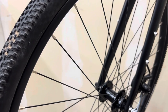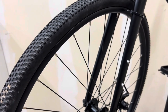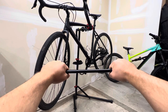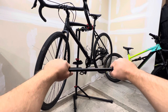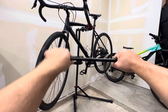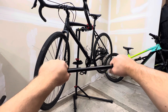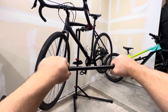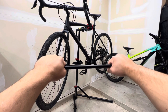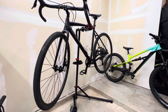We're going to loosen that up in hopes of putting more tension on the opposite side of the hub, and it's going to pull it the other way. To give you a visual reference: imagine the rod I'm holding is the hub in the center of the bike wheel, my left arm represents the left spokes, and my right arm represents the spokes on the right side. If this side has a rub — meaning it's bowed out — we loosen up that left side to straighten it back out, and if that's not enough, we tighten the right side.